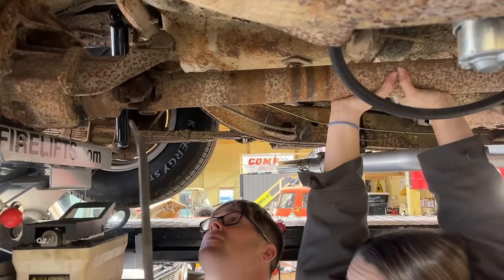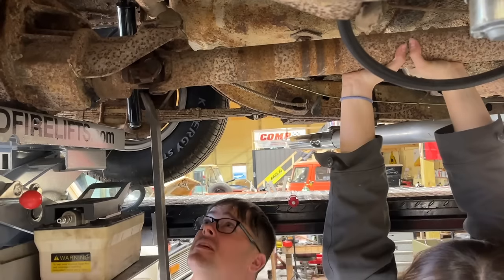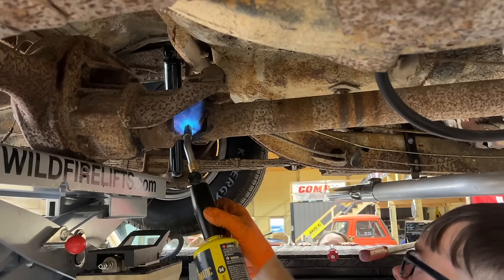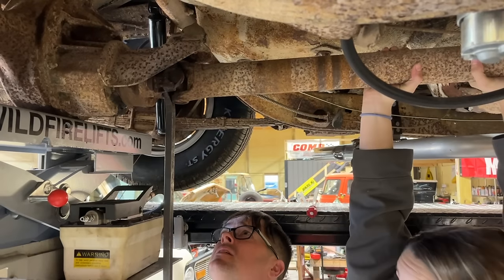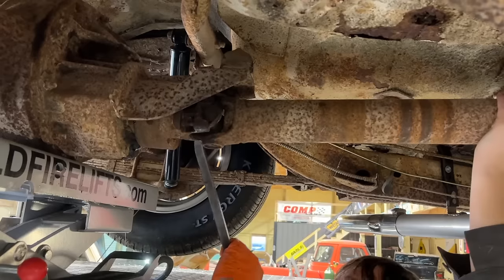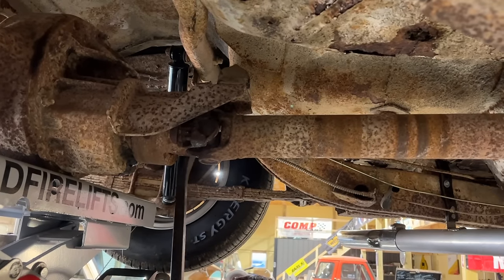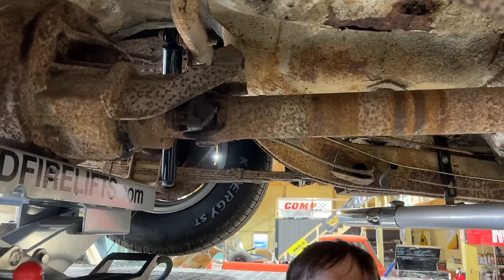That's the biggest pry bar we've got. I mean, the XL model, that's not even budging those straps. We may have to heat them up. Wow. And you'd think that much pressure would take that loose. It's unfortunate, really. So I put the nuts back on the U-bolt straps and I'm prying against them. I've got this one to move at least. I haven't tried the other side yet.